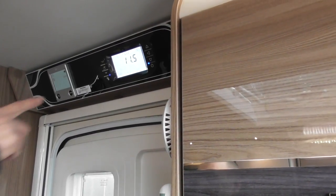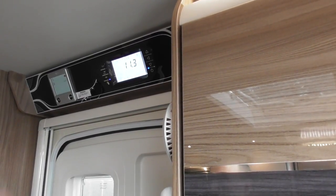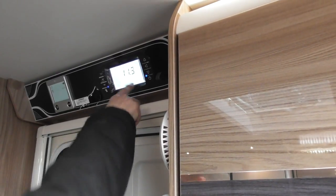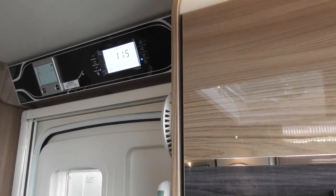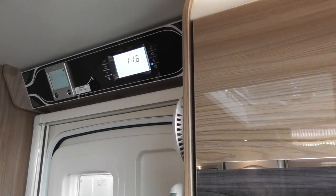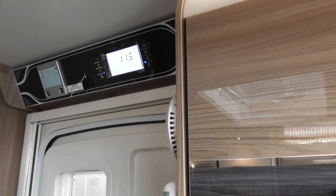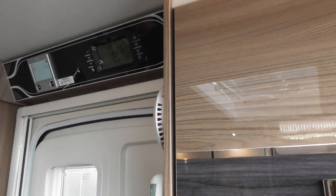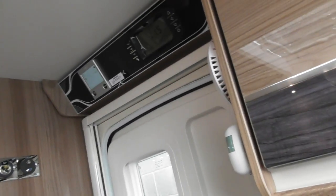This is showing me what amperage is going out. If it goes above that — so I've got it set to 16 at the moment — what it would do if you're drawing too much power on your heating side, as you've got up to three kilowatts on that, it will start dropping down the power on that. So it'll drop a kilowatt, another kilowatt. Normally what happens is if you switch the kettle on, or the ring, or a hair dryer, it will start shutting down the heating — on electric, as long as you're operating on electric.